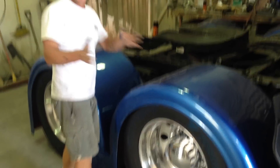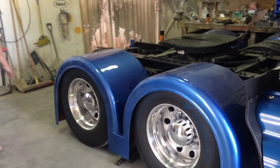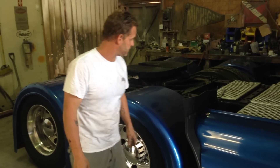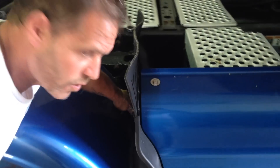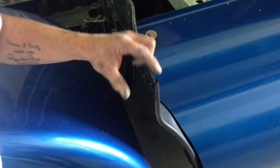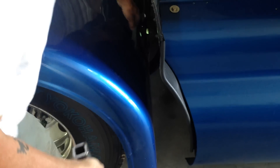You won't have to do that on both sides. Those suspensions are offset to the passenger and driver's side. So you're ready to check where you're going to be marking your fenders and where you're going to notch them out before your bracket is out. I've already been underneath and marked it, but if you want to come over and take a look — you'll go to the most bottom point of your hanging bracket and transfer that mark. Your pipe is an inch and a half, so give yourself two inches so you have a little space on the top and bottom of your pipe. Mark it with a grease pencil on your fender.